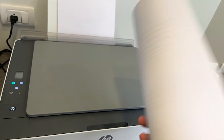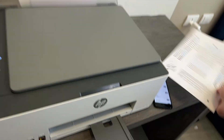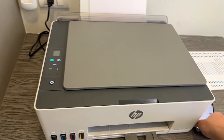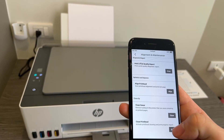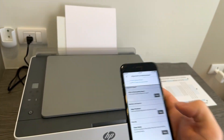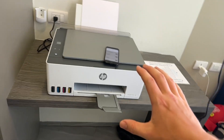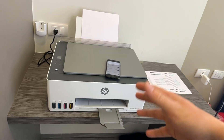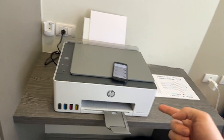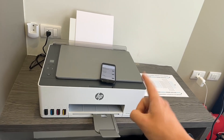You can discard the piece of paper from your scanner — feel free to recycle it or reuse the back if you need to print a document for personal use. Then we're going to go back into the app and do a quick cleaning of the print head, so press clean. As with before, this does take just a minute. There are three stages: the first stage is the more simple cleaning, level two takes a bit longer, and level three is the longest but also the most in-depth. I'd recommend doing all three if you're looking to do a deep cleaning of your print heads, but for now we'll just do level one.